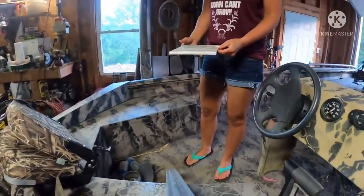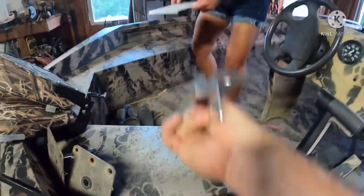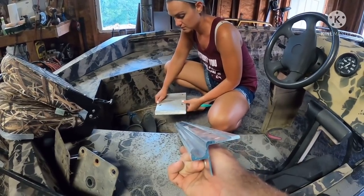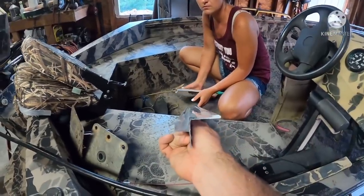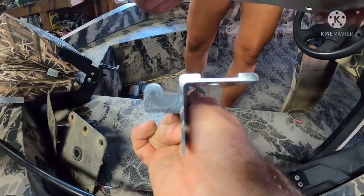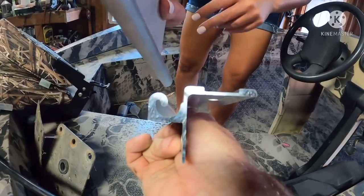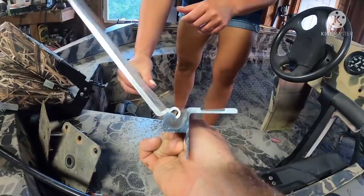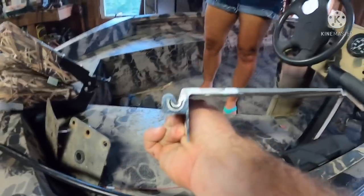But the side that's facing you there, honey, goes into this J channel on the front side of this piece of aluminum. Rotate it. There you go, you see that J? Now if you can come up here so our people can see it all the way to the end here, I wanna hold it right on the end, and you stand that up on end. So just like that, slide the J. Now lay it down. The other way. And that, folks, if you can see that there, locks it in place.